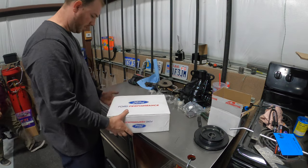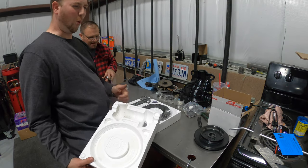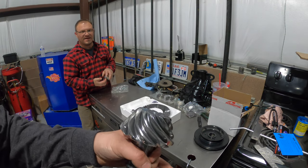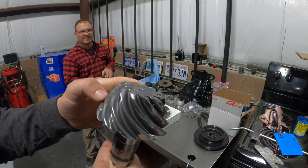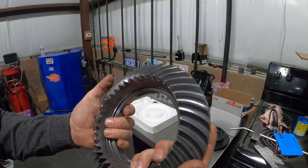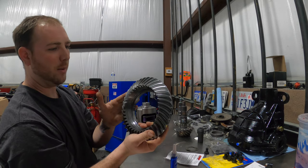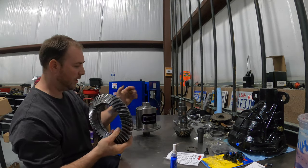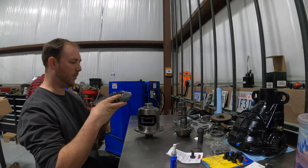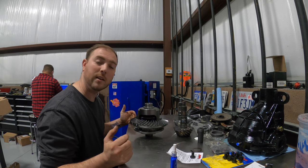This is the main piece - this is the ring and pinion. Everything is micro-polished. We're ready to put that third member together. The 3.55 ring gear, micro-polished by Performance Metals. We're going to start off by putting our ring gear on our Yukon Dura-Grip and fastening it down with our ARP hardware. I'm going to go ahead and time-lapse this for you guys.